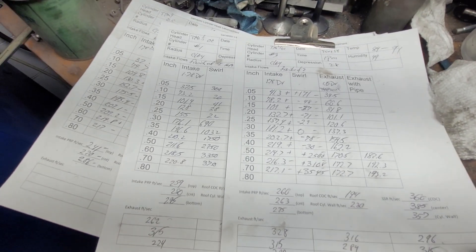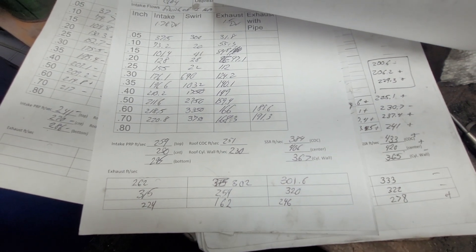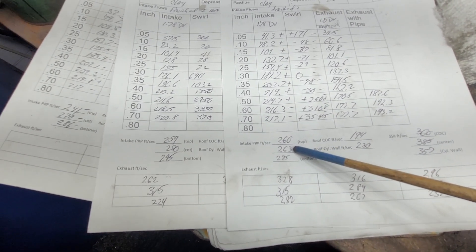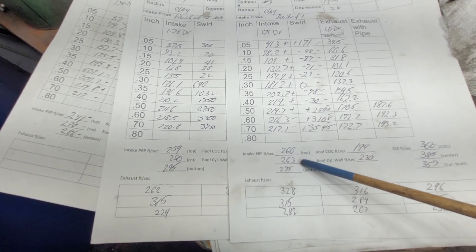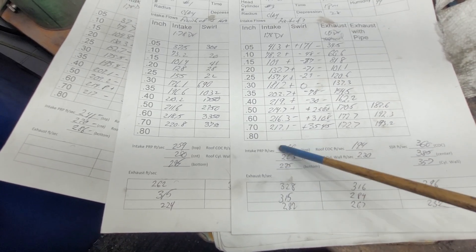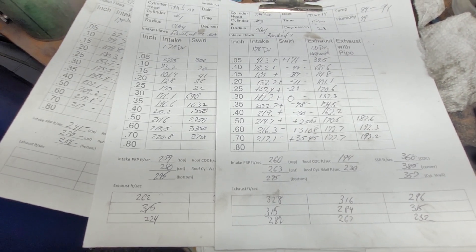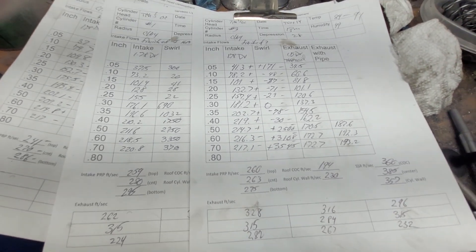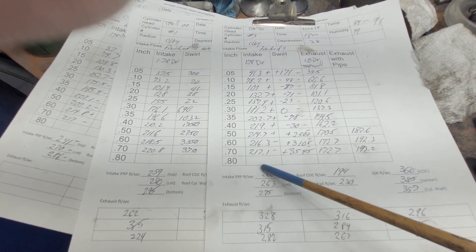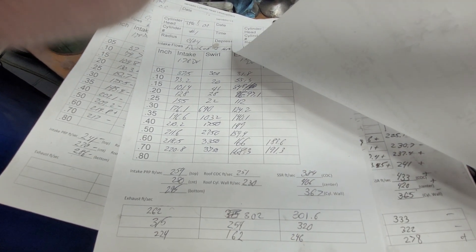Let's take a look at the air speeds in the ports because they're quite different. That is number one. Let's look at our pinch — you wouldn't think it would affect the pinch much. 259, 260, 280, 263 — down a little bit — 295, 275. The pinch is actually a little bit slower on this head. Now the pinches are both the same size within a few thousandths, so if they're moving about the same air — at 600 lift I've got 218 versus 216. This one is moving a touch less air.